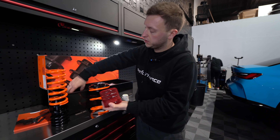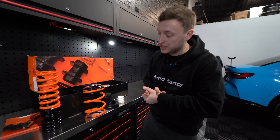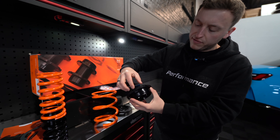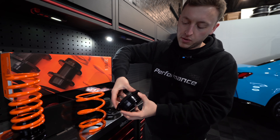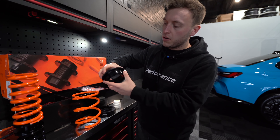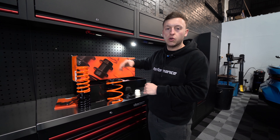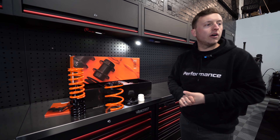When it comes it looks amazing. Let's get this on the car — I'm dying to see how it looks. One quick thing I like to do with all the adjustable collars: I'm going to drop this to about five millimeters gap. I don't like over-tightening them because then you can't back them out, so just leave a little gap, install them, and adjust the ride height from there. Long term we'll do corner weighting and adjust everything accordingly to get the weight correct.